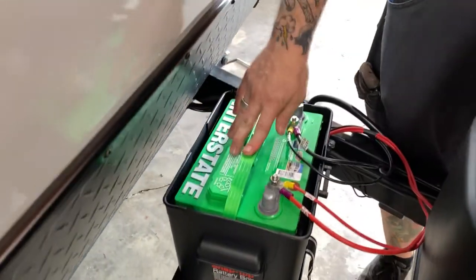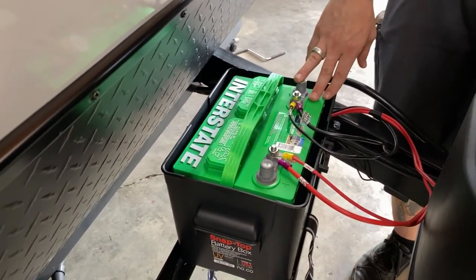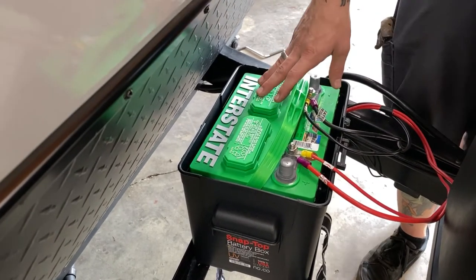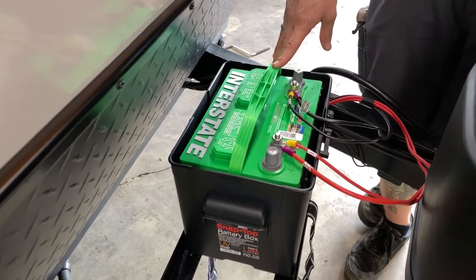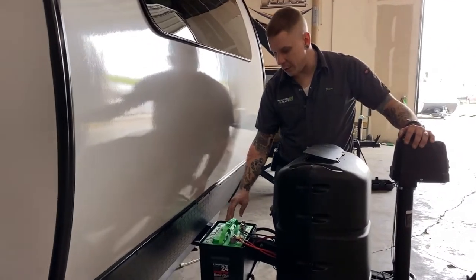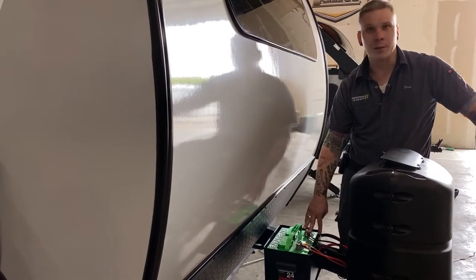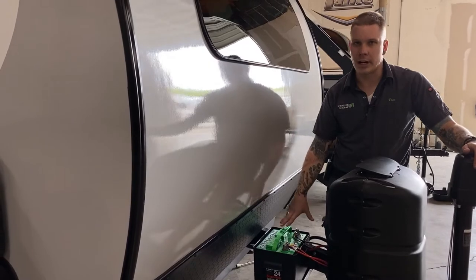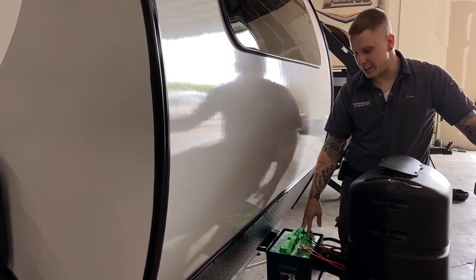We have your Group 24 deep cycle battery here. From a maintenance standpoint, two or three times a year you'll want to pull the vent panels up and refill with distilled water as necessary — there is a clearly marked water line in there. For long-term storage, disconnect the battery terminals and tape them up with electrical tape. This prevents backlighting of displays and other phantom draws on the DC circuit from compounding over months of storage.